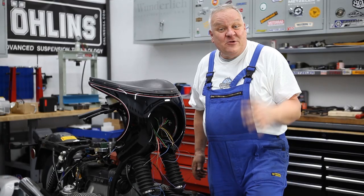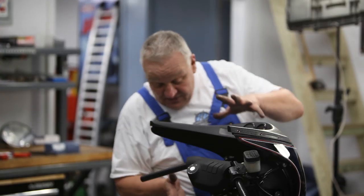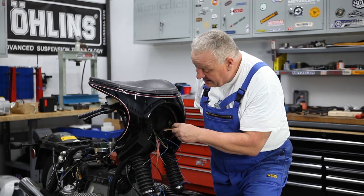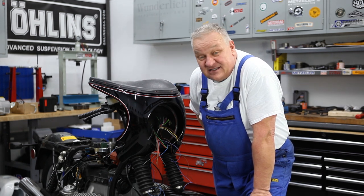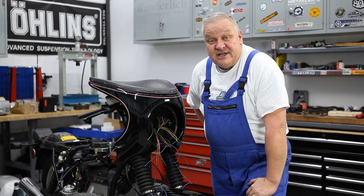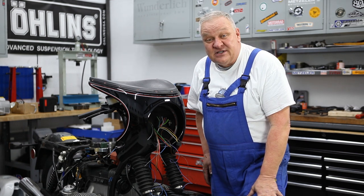I've got the routing the way I like it — it goes along the bracket here to the fairing and ties in with the ignition wiring. Just need to get that grommet back into the hole. We've made quite a bit of progress: we've got our dash pad installed with the ignition switch, all the wiring cleaned up and heading in one direction so we can make all our connections in one spot. That's all the time we have today — next time we'll get the headlight installed and move on to other cool things. Make sure to subscribe to our YouTube channel and join our newsletter at boxer2valve.com!